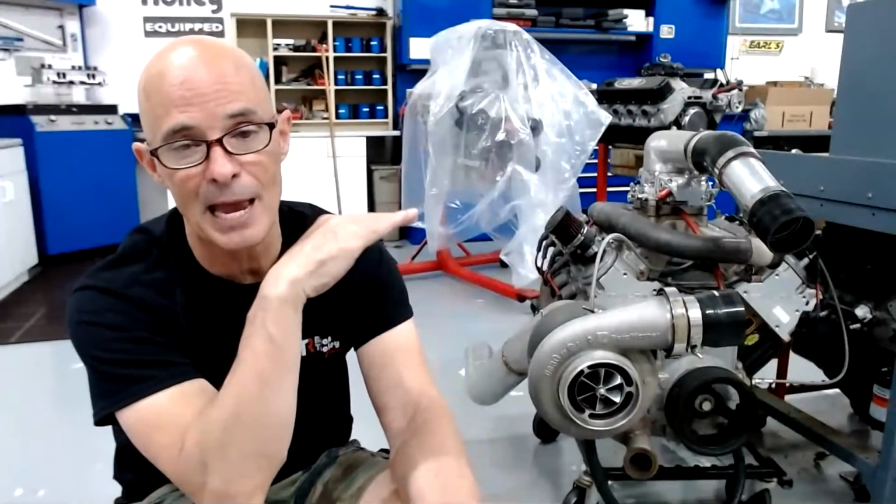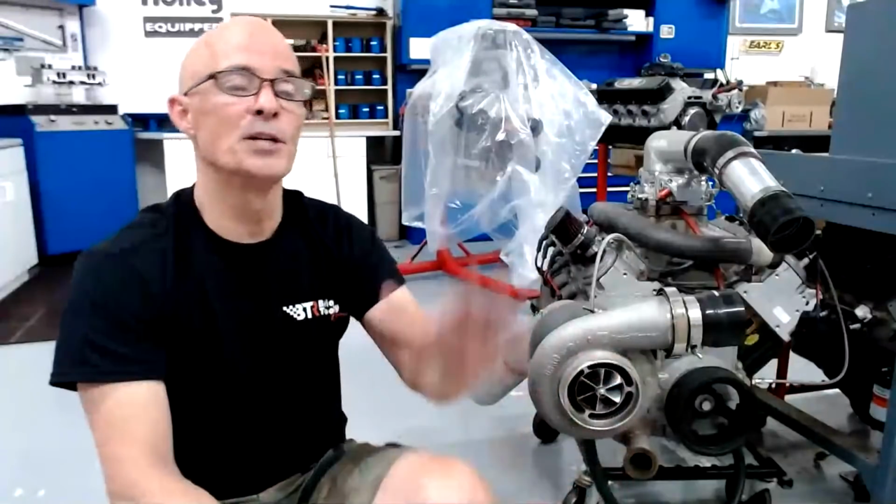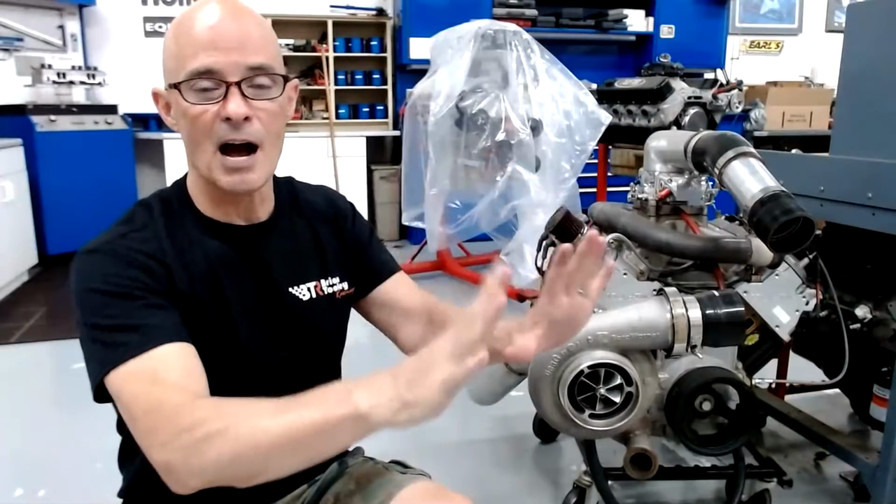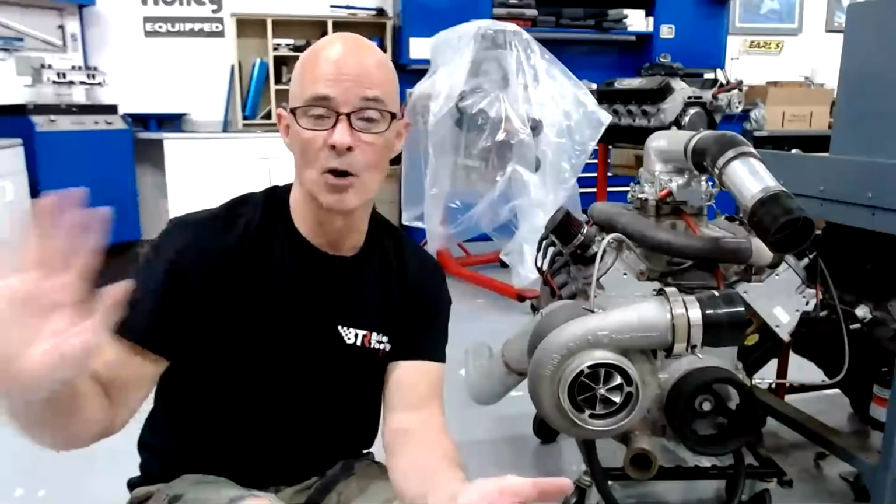If the air fuel that you had on your 7 PSI run is not exactly the same as you had on your 8 or your 10 PSI run, the amount of power gain that you got per pound of boost might be different. And then so when you're measuring that, you're like, oh, this thing is not in its efficiency range. That's a difficult statement to back up, having never seen any sort of compressor map and basing it solely off of that information without taking into account all the other things.